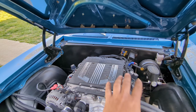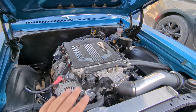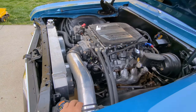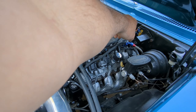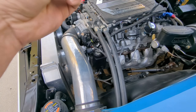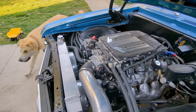It'll definitely blow the tires off anytime — the acceleration and torque is ridiculous. With the computer and the harness, this is an LT4 setup, so this is controlling your boost valve right here, your wastegate system. It's been very smooth and linear. It's very important to have that. You also need to be running multiple MAP sensors — there's a three-wire sensor there and a four-wire sensor in the back, and believe it or not this mass airflow sensor also has a MAP sensor as well, so there's three MAP sensors.